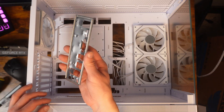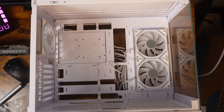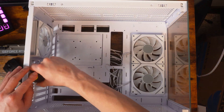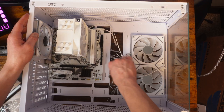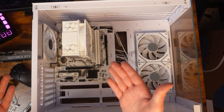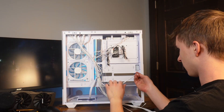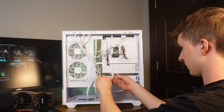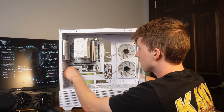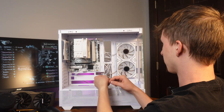First remove the plastic. Now install the I/O shield. Then using this little tool I'm going to move the standoffs to the correct spots. Now it's time to put the motherboard in and screw it down. Now it's time to route all of these case cords into the motherboard — except for the Type-C. HD audio goes in the bottom left, USB 3.0 goes around the middle, and same with the F-panel. I'll just leave up a graphic on what that looks like.